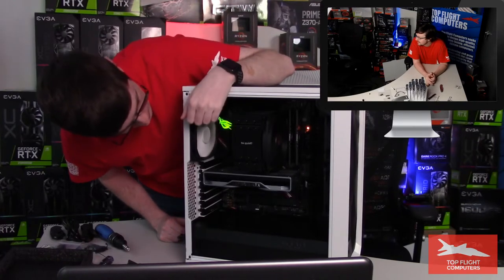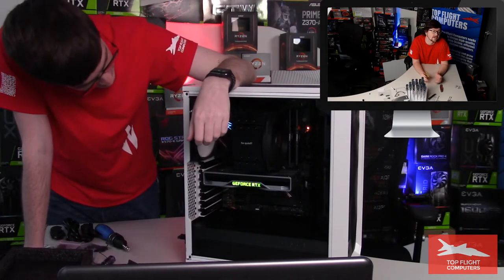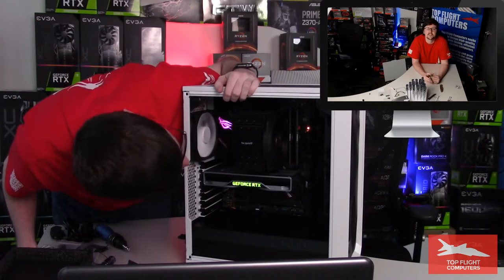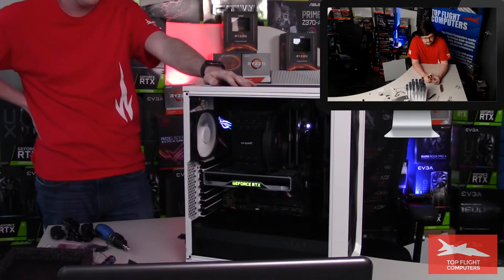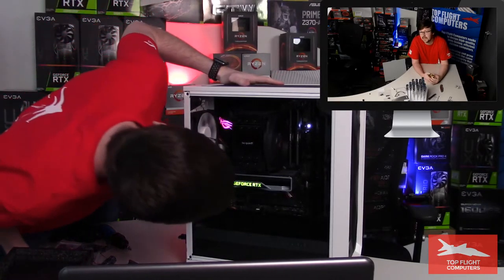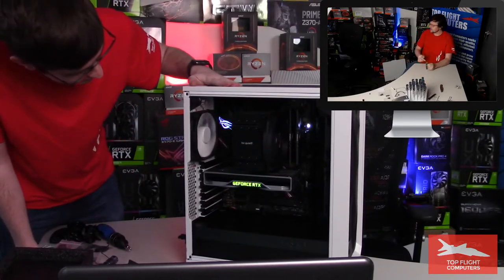Lights flickered. We have fans. So the computer is doing what's called memory training, so it'll power off and power on a few times trying to figure out the speeds that it needs to be able to run everything and what kind of hardware is inside of it. So it's identifying that as it turns on and off. Yeah, on first time boot, or when you change something. So it'll ramp up, ramp down, ramp up, ramp down. It sounds like it kind of leveled out, so odds are it's probably trying to figure out a postcode now. Boop. And we have a boop. That green LED. Perfect.